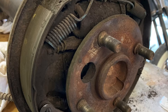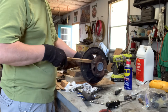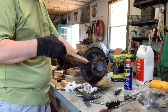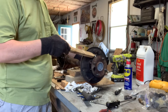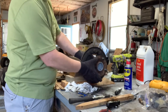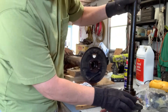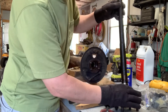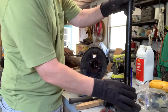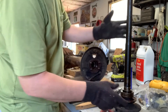Just a shot of the brakes. I'm getting ready to take them all apart and pull the axle shafts. To get the shaft out — I didn't realize it, but I've always worked on Chevys — the bearings are pressed onto the axle shaft instead of inside the axle housing. So I had to just get a block of wood and a hammer and tap it back. It came out pretty easy after that. There's a collar on here and I've got some pretty good wear on there. The bearing doesn't seem too bad, so we might be able to reuse it. It's 54 years old though, so we may just get new bearings. Just dirty as heck. We'll get everything cleaned up and go from there.